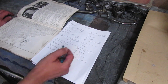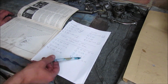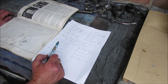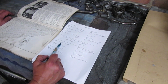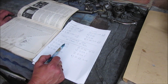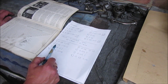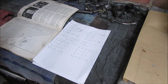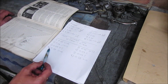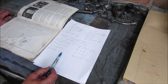Alright, so I've just gone back through, just done some more calculations on it, where some of them I've actually got the choice. I'm going to base it around the 0.09 area. So in cylinder 1 I'm running 0.20. I've got a 2.50 shim. I want to get down to 0.10, which means I'll put in a 2.6 shim. Now cylinder 2, where I am within tolerance, but to bring it level so everything's running at the same, I'm going to put a 2.5 in there. Number 3 is fine. Number 4, I'm going to go for the 2.6, so that brings it down to 0.09.